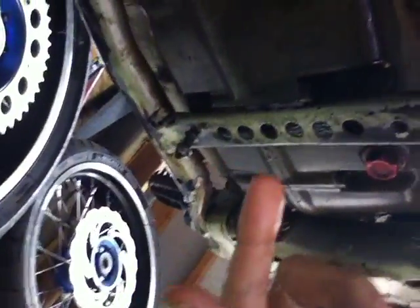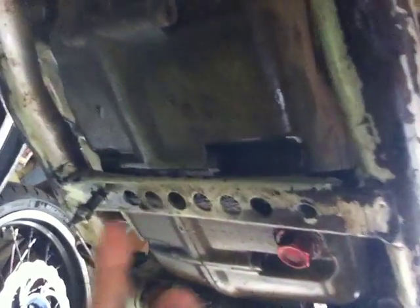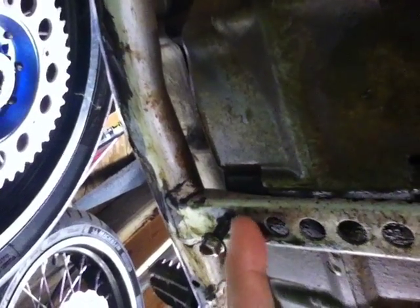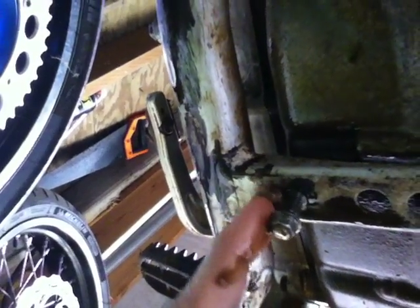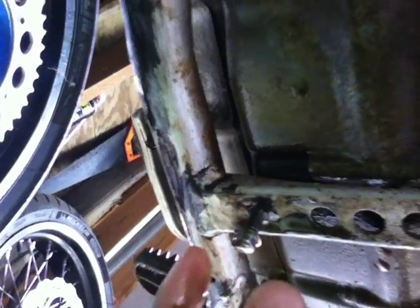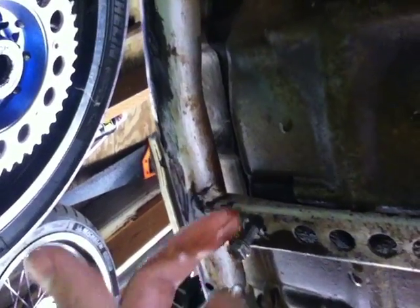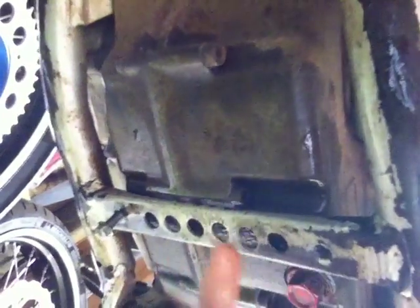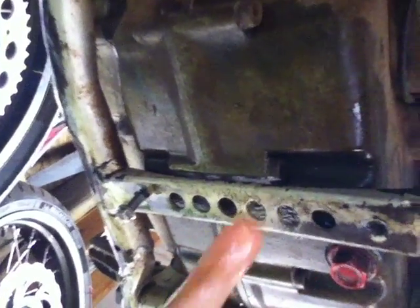Here's my thoughts — tell me if this works if any of you guys are savvy. I think this bolt location where Yamaha tapped it is an awful spot, right under the crankcase. I don't even want to put another bolt through there. But right there, just about a quarter inch off, is fine — it's got a lot of clearance. I was thinking about dremeling the bracket right after this bolt, right after this hole, just so I have two little metal nubs sticking out. This bracket isn't much of a support brace — I'm suspecting Yamaha just put it there for aftermarket skid plates.